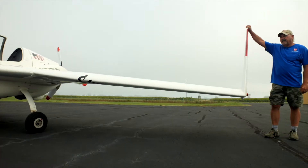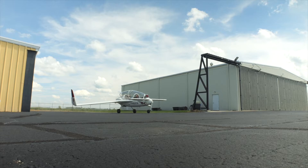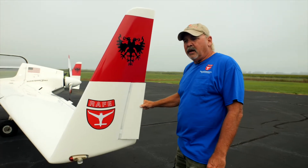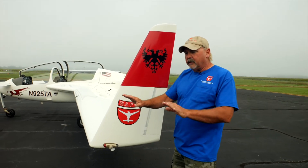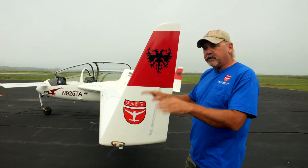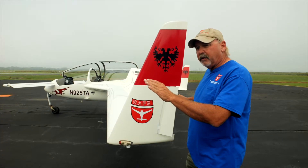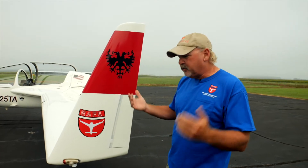This winglet is really uncommon in general aviation — you see them on airliners a lot — but the big difference between ours and the ones on airliners is we have a movable flight control: this is our rudder. The rudders on the Speed Canard don't work like a Cessna or Piper where you step on a rudder. Our rudders work independently and you can step on both rudder pedals at the same time. We don't have toe brakes — the rudder pedals press out, the rudder comes out, and then the last quarter throw of the rudder pedal is the brake.